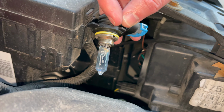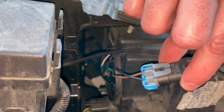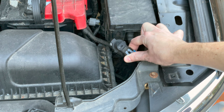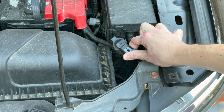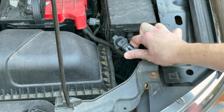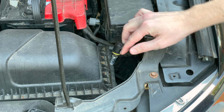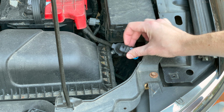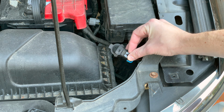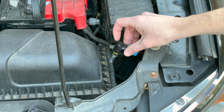And this is what the whole piece looks like when you're sticking your hand in there to feel it. And it's got this blue connector at the end, a blue and gray connector. Just want to make a quick note here. There's only one way for this bulb to go back into its housing, because you have these 3 different tabs and each one of those is a different size. So it fits specifically like a kid's puzzle where you can only put specific shapes in. It's only going to go in with those specific tabs sticking out. So you'll want to remember the orientation in which you took it out, where this elbow was, or how it felt like it was in there once it started coming out. Don't try to force this back into the housing. Know that it has to feel a certain way before you can lock that back in.